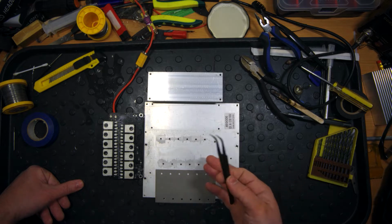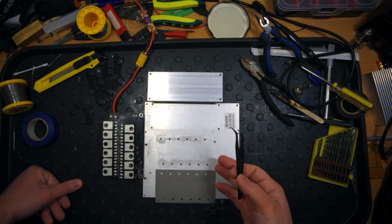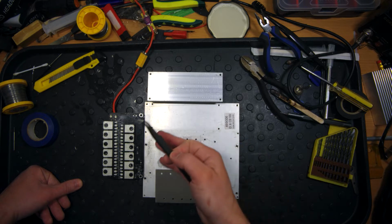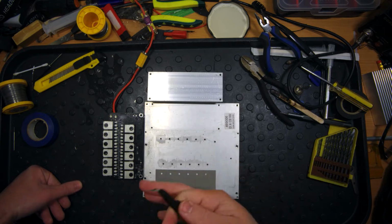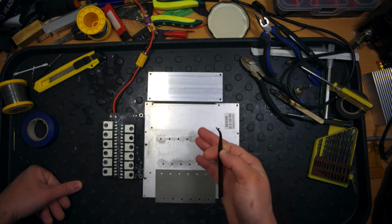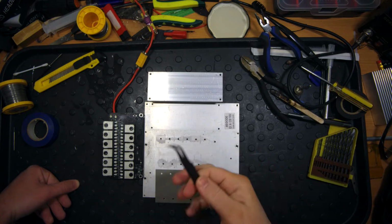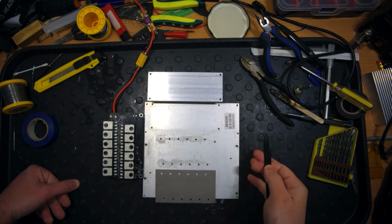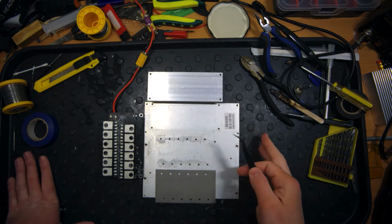And this really explains the problems Begode has with overheating their wheels like the EX-N, because the main cooling system requires a rebuild before you can run your wheel safely at high speeds, without worrying about burning out your controller, falling from your wheel and going to the hospital.